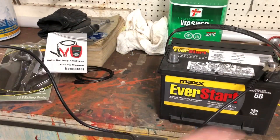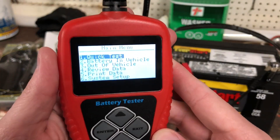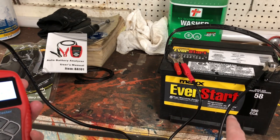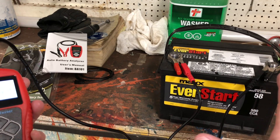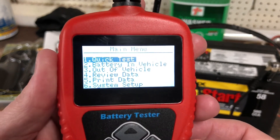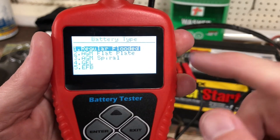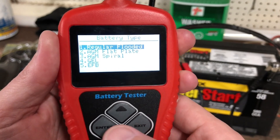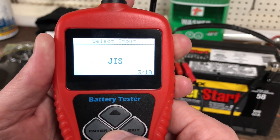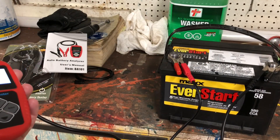I'll plug in and connect the negative, connect the positive. And that powers it up. I'm going to do a battery test, and there's an option to do in the vehicle or out of the vehicle. You need to look at the cold cranking amps. On this battery it's 580, but this battery has more or less been unused for the last month, and it's been pretty cold out - about minus 15 Celsius. The battery's out of the vehicle, so I'll go down and select that. You can test AGM batteries, regular flooded batteries, different types of batteries. I'll choose regular flooded. Then you can input what kind of measurement you want to test against. I'm going to choose CCA, cold cranking amps. I've pre-entered 580. Setting rate, and I press enter, and now it tests.